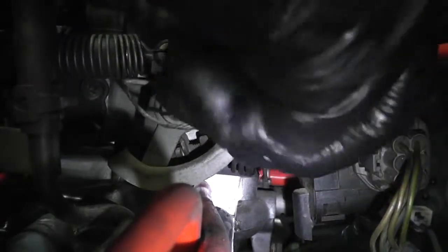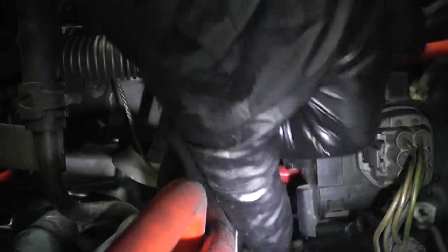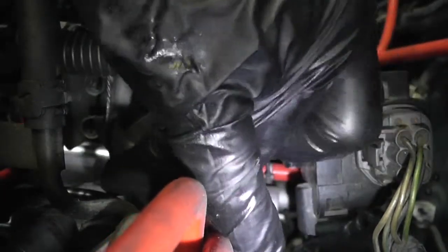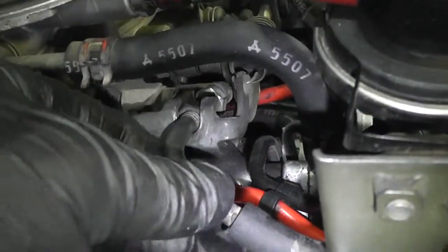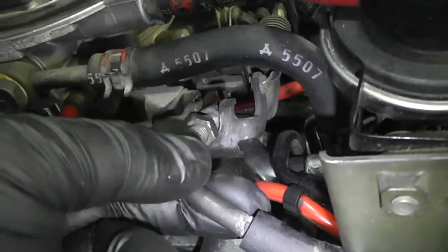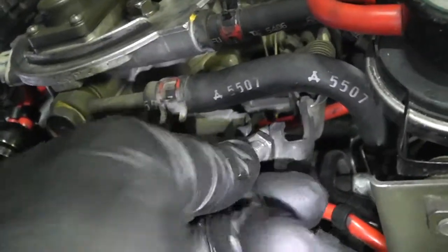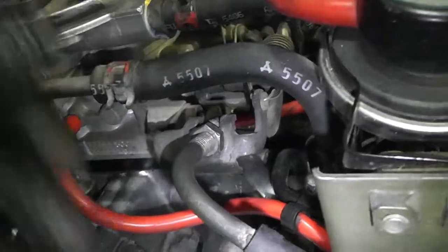So yeah, there we go. Okay, that's how you do it. Barrel goes in, all the way in, and then this thing's gonna thread around. And then to give myself a little slack, all I do is push the accelerator. And then let it tighten. Perfect. Okay, so now we're tight. And then all I gotta do is pick this up, slide it into place, tighten this down. And now, when I push the pedal, it will automatically pull on this, and it looks good. So, hooray! That's that. Okay, I'm not hating my life right now.